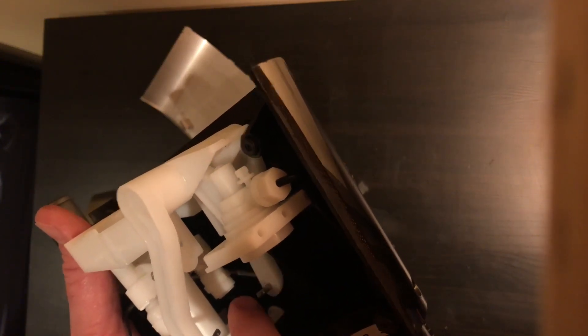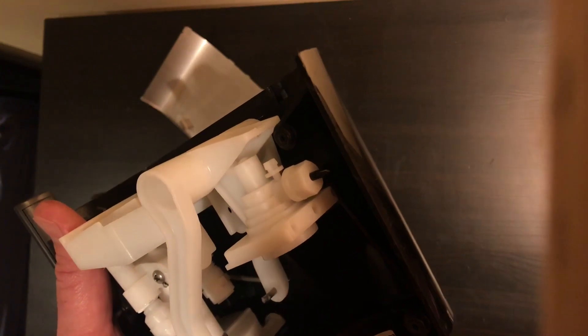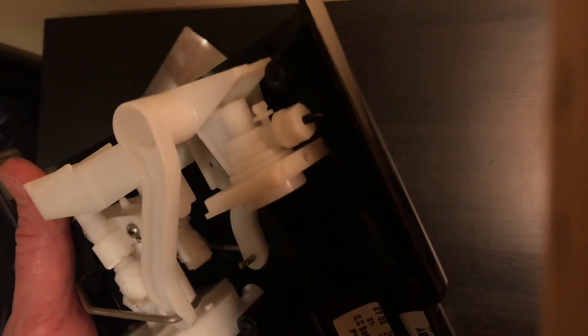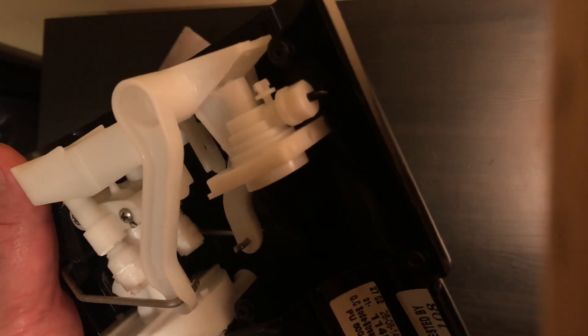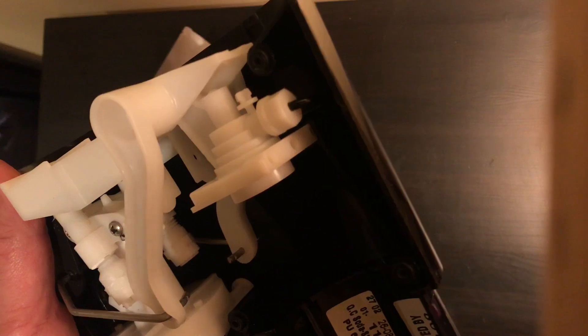When I went to put CO2 in, the water was just spilling out through the relief valve the whole time. So I put some pipe thread Teflon tape on there and screwed it back in. I've also heard people talk about the pressure release valves going off too soon — I imagine swapping out those springs for stiffer springs would help, but then you're gambling that the whole system and the bottle will take that pressure.